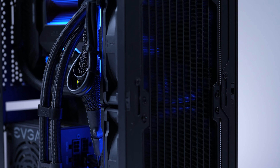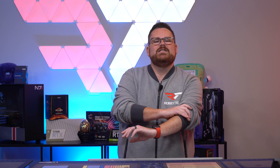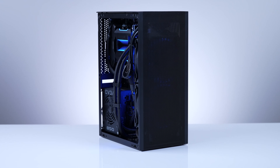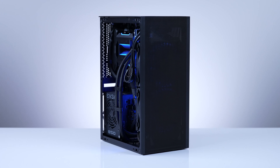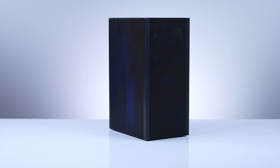There's still room in the build to jump up to a 280mm AIO if I really wanted to push things. One thing worth noting is that you will more than likely see some temperature jumps if you decide to go with tempered glass. The recommendation is to use the tempered glass panel on the motherboard side rather than the GPU side, especially if you're using an AIO. If you're going for an airflow-only build, skip the tempered glass entirely — go all mesh.